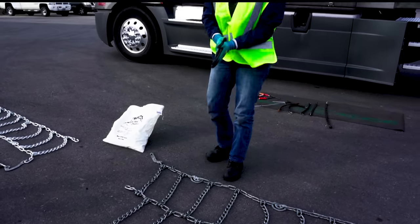It's very important when we're hooking a chain with the drape method that we always connect the chain link that is in between the tires first. Whether it's a double chain or a single chain just going over one side of the tire, we have to connect this first. The complication is you don't have a lot of room between the tires. So we've got to find a way to get the links hooked all the way to the bottom, bring those together - the link and the hook - to make that connection. Then we're going to move to the inside and connect that as well. You can hook a bungee to the end of your links and then take that bungee and feed it over to yourself so that you can pull those links to you.